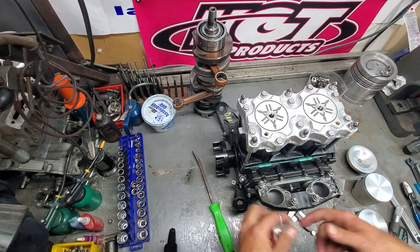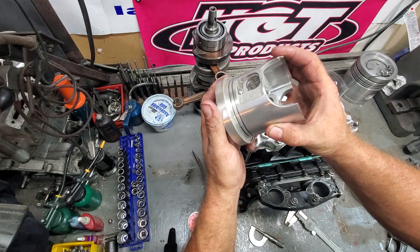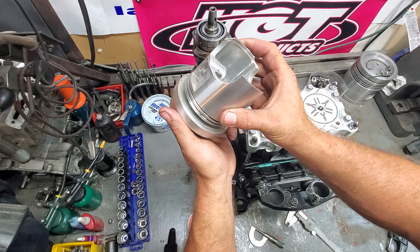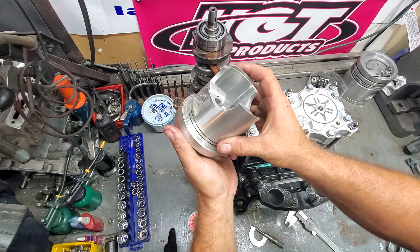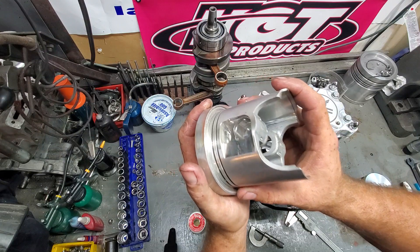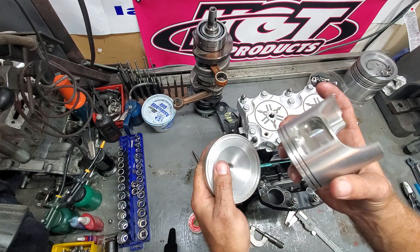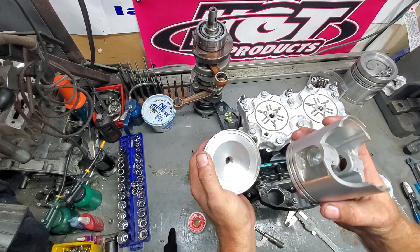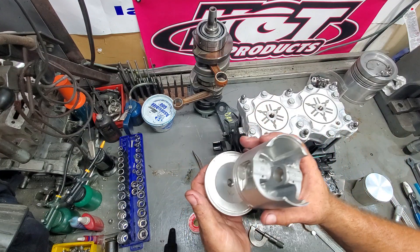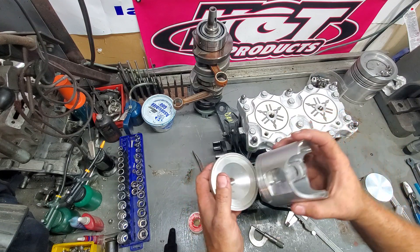That's basically all you need to know. The squish you're measuring is the distance between the piston and the top of the dome — that small area. The main idea is to have it tight enough that it's not going to detonate, but not so tight that you trap a tiny fuel mixture that's going to start exploding there. That's where there's a very fine edge, and it really depends on the type of motor.